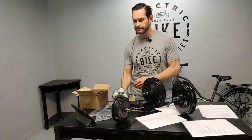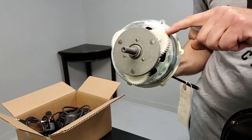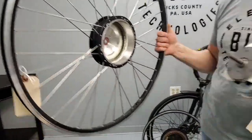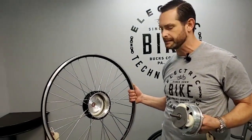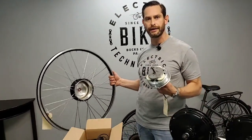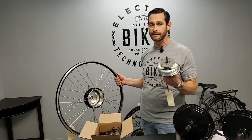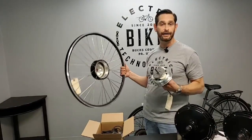Here I have the insides of a geared motor. It's called a geared motor because you have a clutch and these three nylon cogs. These cogs fit into the shell of the motor, and that's what actuates your wheel. This means there's friction inside here, which means it can build up heat under pressure — say over 250 pounds — and with enough pressure you could actually break the teeth. This is why it's important to go by total load, over or under 250. Too much load and you may have problems. Otherwise, under 250, this is Performance because it's a little more torquey and has higher top speeds.